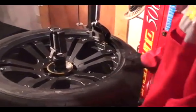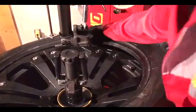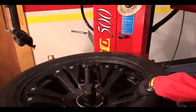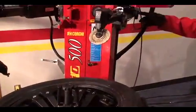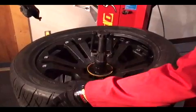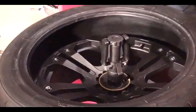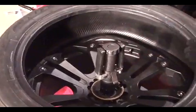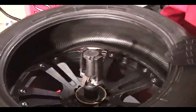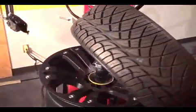Top bead is out. Now, to do the bottom bead, I'm going to use just the roller. I make sure it's free to move and take the top bead breaker all the way up. If I don't have enough room with this handle, I can just open it and take it off my way. The trick is always to keep the tire in the drop center at the opposite side of the bead breaker, so I will keep my left hand right here. I come up with the bead breaker, and as soon as I see the disc, I can open it, raise it a little more so I'm not touching the rim, and spin. The tire is off.